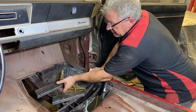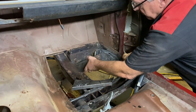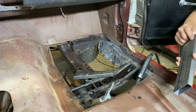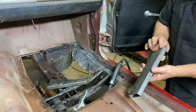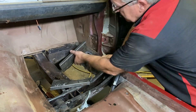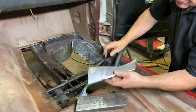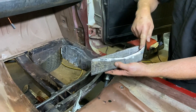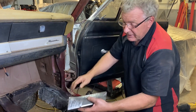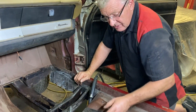Got our pieces made now, trimmed to fit. That's going in there — trimmed a little bit more of this bracket away mainly so we could get to the front side to weld it to the chassis rails. Otherwise with that bracket there you couldn't reach them. This one we've had to contour quite a bit as you can see, to allow the floor to sit down flat — without that the floor was riding up on top of it. So that one goes there, and I'm just going to start burning this in.